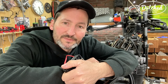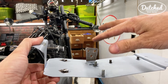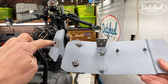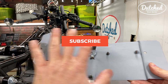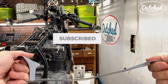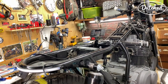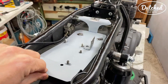Now this is the ground plate I made. I'm going to put the CDI, the starter solenoid and the M unit onto this thing and this will ground to the bike. This will give me a nice ground and will also be the ground for the battery, so all of this can be grounded with this one plate. I did this so I can keep the underbelly of my battery tray nice and clean — no holes in there. It just slips right into there.